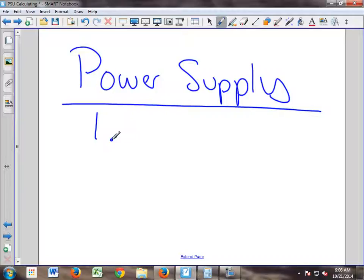Okay, let's be more specific. There's something wrong with the power supply. It's my first guess. The fan. The fan! The first thing that we notice is a fan issue, okay? Every single time that particular item has happened, I'll turn it on, and I'll either look at the back of it, or in the case of some power supplies where the fan's on the inside, there's just holes in the back, I put my hand over it. If I don't feel airflow, or I don't see those blades spinning, the fan is busted.